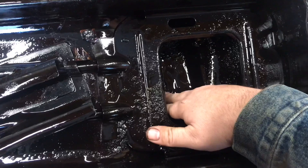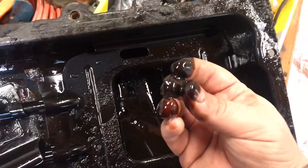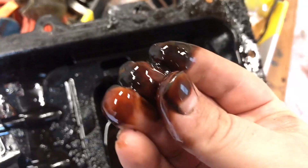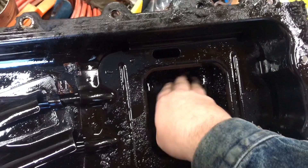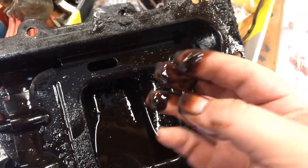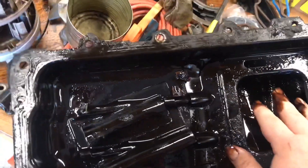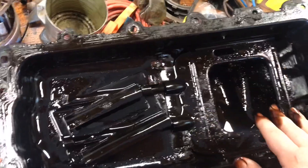There's actually quite a bit — I don't know if you can see — there's some sludgy metal debris in there. The timing rails and timing components are going to have to be changed out, and that's no big deal. After this thing is done it's going to be really nice. I checked to make sure there wasn't much wear anywhere, and there isn't.